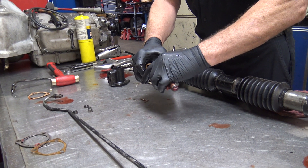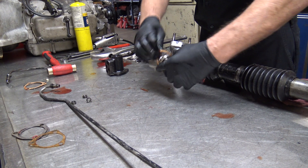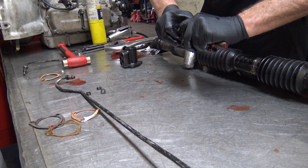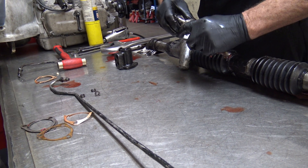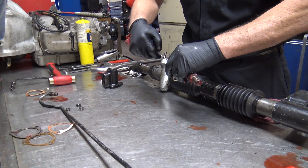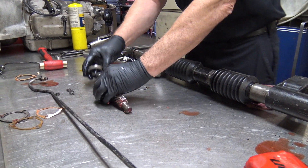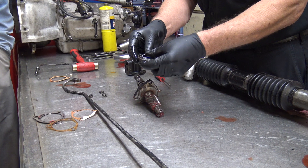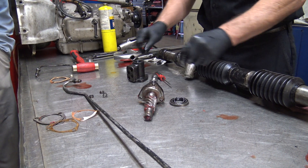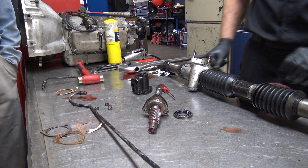This right here is your lower seal plate, which I'm going to pull off. That one's broken, but that's okay — it really should never see any fluid; it's more just to keep out dust. So this seal down here faces up. When this is all together... let me get this other seal out and I'll show you.